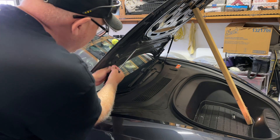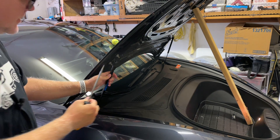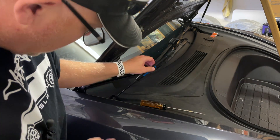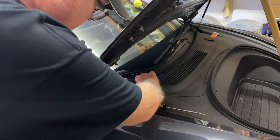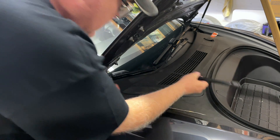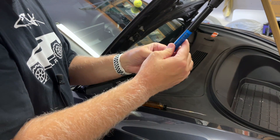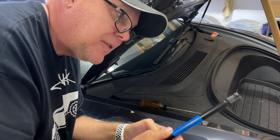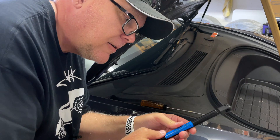So the clasp is slightly out of the way. This should pop off like that — the wood is holding up the frunk. On the bottom part, you just want to pop it off. You go toward the driver side and it should pop right off. And there you go. Here is the one I purchased from Amazon — it's very much like the OEM, it just has a little more force to it.